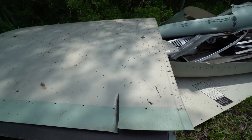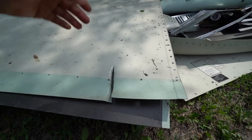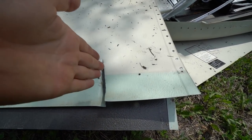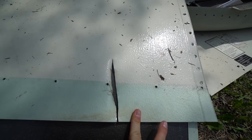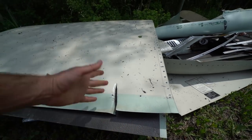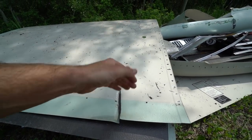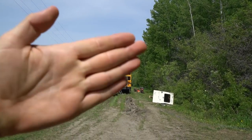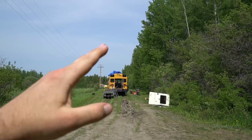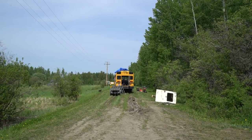When you take apart your bus, it's smart to keep some spare parts on hand, like this metal you can reuse. You can cut out perfectly exact square or rectangular 8-by-16 pieces. I'm going to take the grinder wheel and cut out four pieces, then place them on the inside where the lights used to be, tack weld them, and put a little Bondo to make it nice and flat. That is a potential spot for some advertising or logos. That used to be an emergency exit.